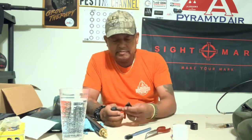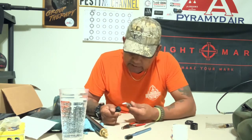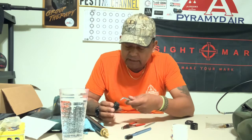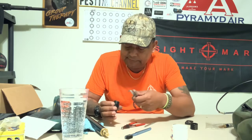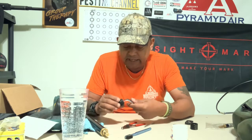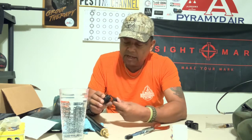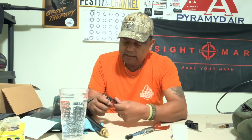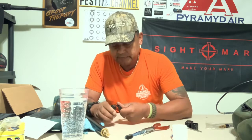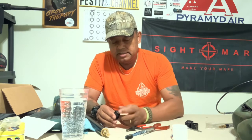And the reason why you gotta have some snap ring pliers or some bent needle nose is the problem is inside here, and you gotta get this cap off. You got all these holes here, and the only thing I could think of was some bent needle nose pliers that fit in the hole like so. Or if you have snap ring pliers, this will do the same thing too. Only thing you gotta do is turn counterclockwise, get it off. That's pretty much it right there. Unscrew it.